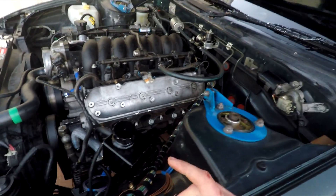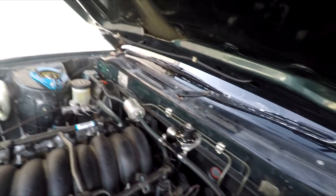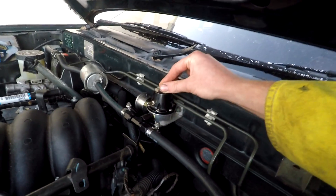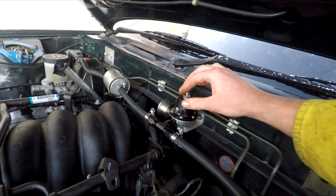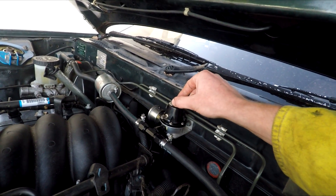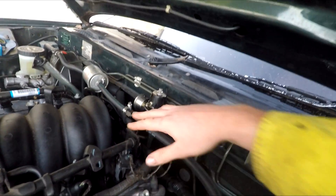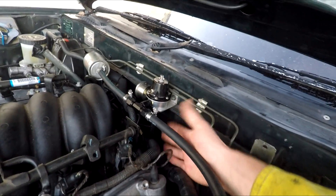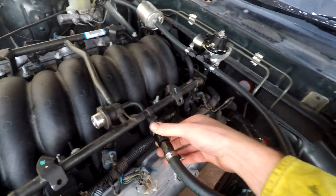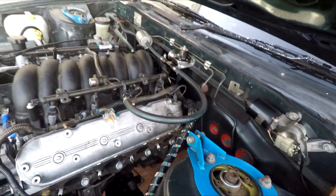The wiring harness I'm not going to touch on yet as that'll be in the next video. For the fuel system, the fuel lines are bent up as shown in a previous video. I've made a little bracket to mount the fuel pressure regulator on the firewall off a factory bolt. The fuel line tees in rather than going through the regulator because the fitting is 1/8 NPT - not big enough to supply fuel through it. It just tees off to work as a line relief, maintaining 58 PSI as GM requires, then goes down to the return line back to the tank.